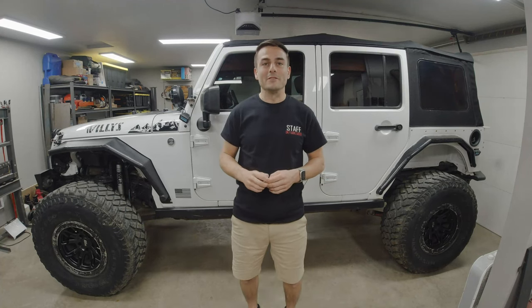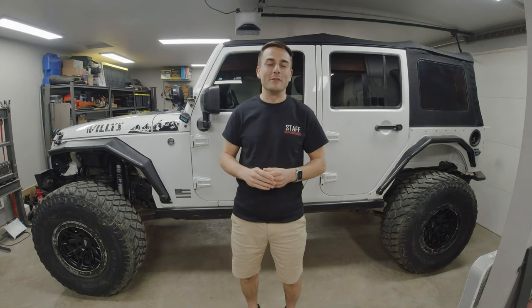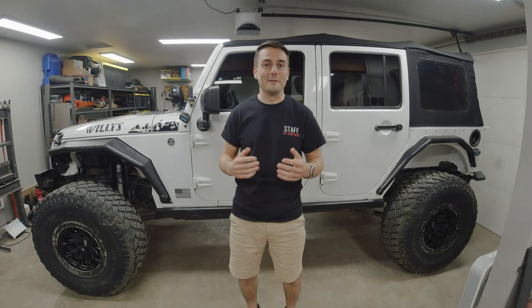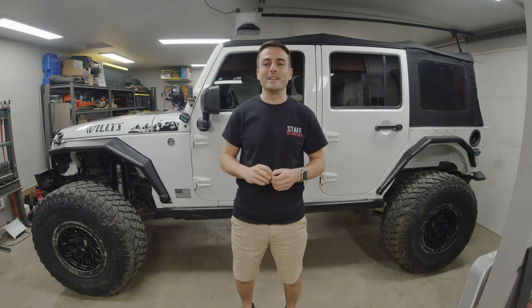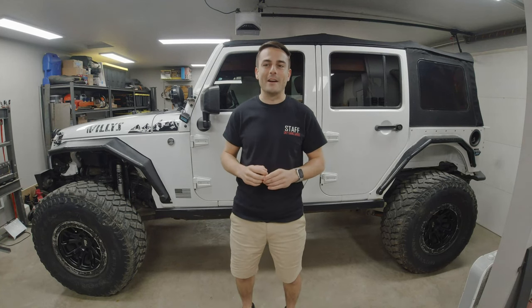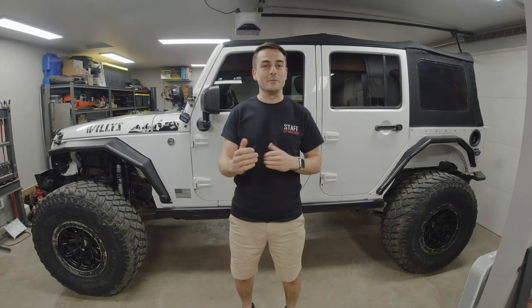Before the recap, I'll drop a link to my previous first impressions video, which goes into more detail on why I chose these tires and their specs. I purchased five 37x1250 R17 Firestone Destination MT2s. They are a load-rated D tire with three sidewall plies and seven tread plies. These tires started off on Pro Comp steel wheels, 17-inch diameter by 9 inches in width.